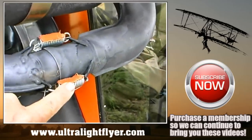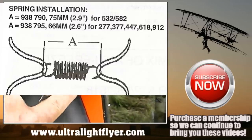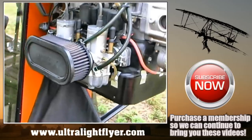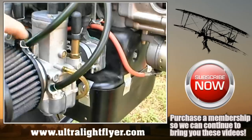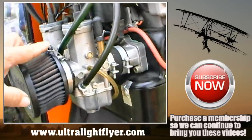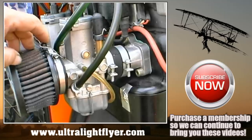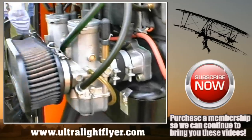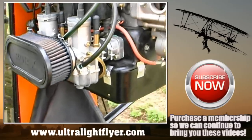This spring here is under tension — it should face just like the other one. It's a spring more likely to break because it's not installed properly. This is the style of air filter they want to use, and again you can see that if the air filter comes off, the clamp is still near the propeller. So again, run the safety wire underneath the clamp and back to the carburetor to prevent the air filter clamp from entering the prop.